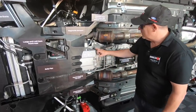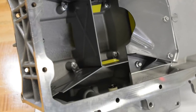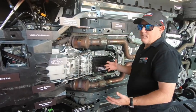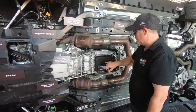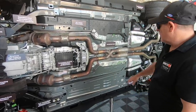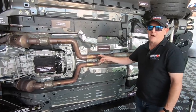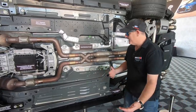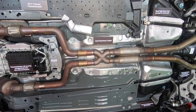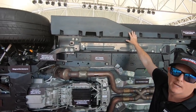One interesting detail: the oil pan integrates to the transmission with through-bolts, so it's more than just bolted at the block — the transmission bolts to the entire engine including the oil pan, adding to the structure. That's really helpful in cornering where things flex and move. Here's the 7-speed DCT with its built-in oil pump, exhaust heat shielding, and through the middle of the car a relatively simple X-pipe with large pipes. There's also an add-on aerodynamic downforce piece visible on the side.